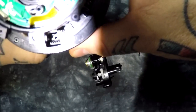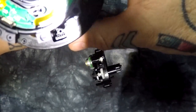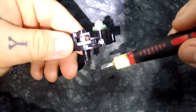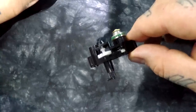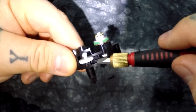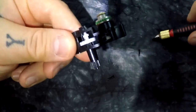The entire lens — remember, this is an AFS motor. The weakest link of this is what's interlocking with the entire autofocus assembly. It's all plastic. That's a tough gear, that's a tough gear, but this is a smaller gear. If you get the slightest bit of debris jammed in here, it'll seize up, and then the motor will try to drive this nylon gear on the shaft of the micromotor. It'll hit this plastic gear, then this tougher gear, but then it interlocks with this tiny little gear here, which has 12 teeth.